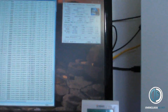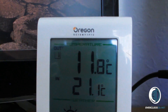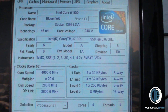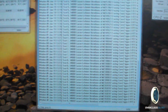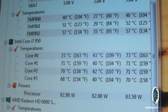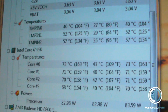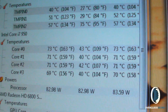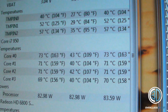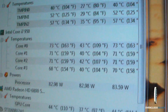The room temperature is 21.1 degrees. When I took my temperatures it was 21 degrees dead. Currently testing at 4GHz at 1.25 volts — Prime has been running for just over 30 minutes. My temperatures were 73, 71, 71, 68, giving an average of 70.75 degrees C. Take the ambient temperature of 21 away from that, and that gives us a delta temperature of 49.75 degrees C. Right, let's move on to 4.2GHz testing.